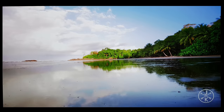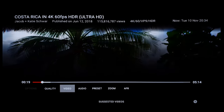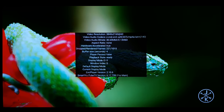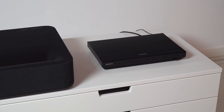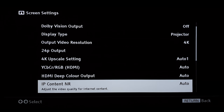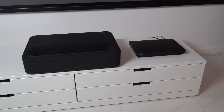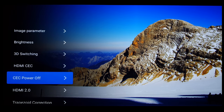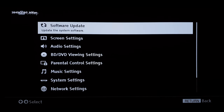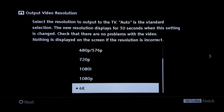Previously the built-in YouTube app only supported 1080p, but now it supports 4K as well, so you don't need any external device to watch 4K YouTube videos. For Netflix you still need an external device like an Android TV box or Blu-ray player. I'm using a Sony 4K Blu-ray player which supports 3D, HDR10, and Dolby Vision, with built-in 4K support for both YouTube and Netflix — and the projector performs very well with it. Also, no matter what external device you use, you should always give this projector 4K input even if you're watching non-4K content, as the software will not apply video noise processing and you'll get much better picture quality.